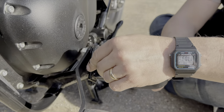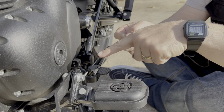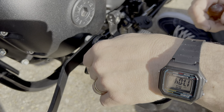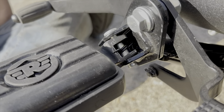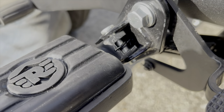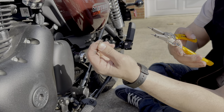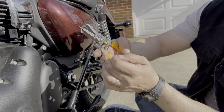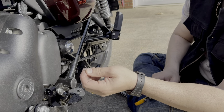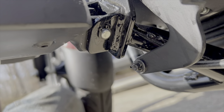So this goes in like that — you have to put the spring in. There's a little hole that goes in towards the bike, and then this part goes down on top. There we go. That's how the ring goes; there's a little hole in there — I'll show you with the screwdriver. Now I'm going to put the snap ring on. Important on the snap ring: because it's so wide right now it's going to slip right in — you have to go from loose to tight. We got it — there we go, it's on. There's the snap ring.